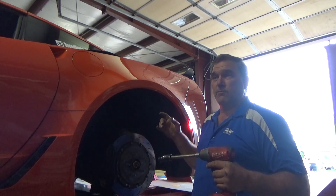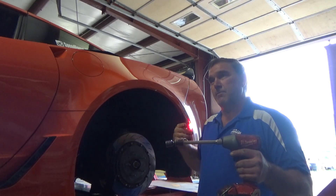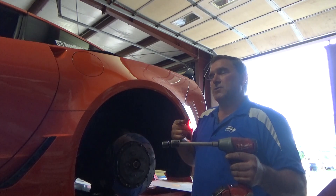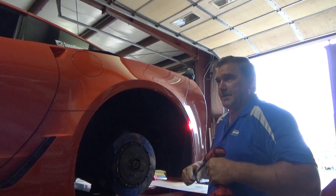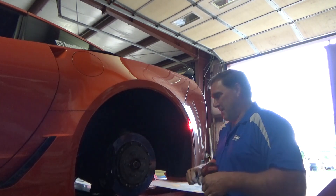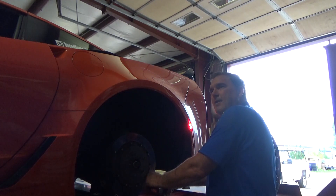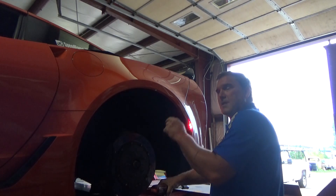It makes sense - with the upper and lower ball joints, when you move the front joint it moves your ball joint in and out, but moving the back one also moves it forward and back, so it throws a weird caster into the car. I learned about it the hard way when customers said 'it pulls when I accelerate - the back end pulls.' I figured out what the tool was and bought the GM special tools. I ran into that with Carlisle cars because they didn't have the bosses in it - they ended up putting slots in there for the tool on the next production run.